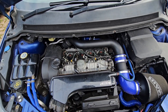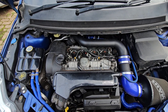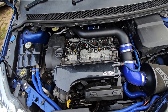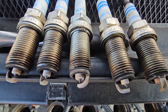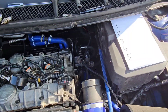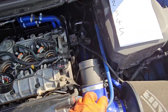Right, so in a minute I'm going to take the plugs out, the coil packs off, and do a compression test to see what's actually going on. The car runs fine - haven't had any problems apart from the misfire on number five, and that was only for five seconds when the engine light flashed up. Here's my piece of paper to write down the results. I've just screwed it into number one. I'll put my foot on the accelerator when I turn it over and do about five cranks on each.